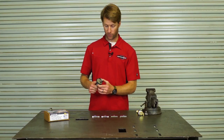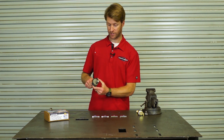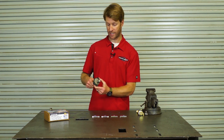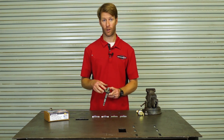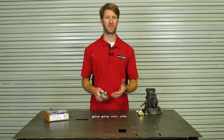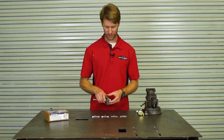Even if you have a gusset kit, the cams under a hard hit — depending on where they're set — can shift very easily. That's a long-term problem because every time you go out and have to align your vehicle, that's not really the most enjoyable part of it.